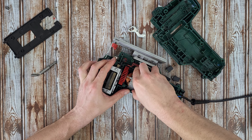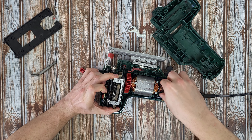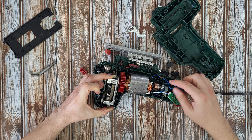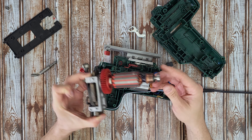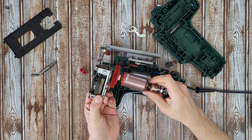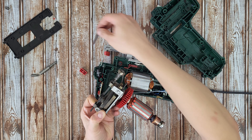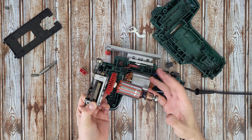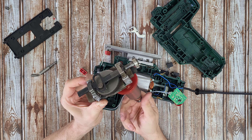Let's remove the motor. We need to be careful because we've got two cables connected here at this copper contact. There is the motor. Now — how it works: by rotating, the motor drives the mechanism up and down. If it is connected to the saw blade for wood or metal, it goes up and down and starts cutting. It rotates at a high speed — maximum 3100 SPM — and you can see it going up and down.